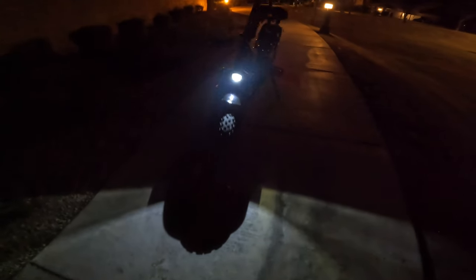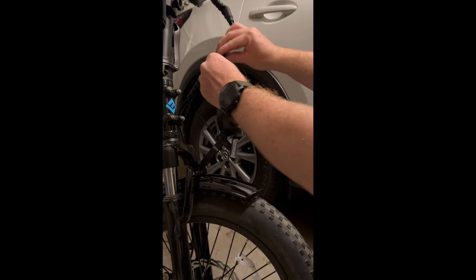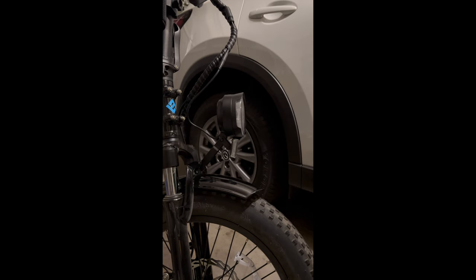The Electric XP 3.0 comes standard with a headlight and a tail light. Unfortunately, the tail light doesn't get any brighter or flash when you apply the brakes — I'm hoping to see this in a future iteration of the bike. It also doesn't have any turn signals, but neither do most road and mountain bikes. The stock headlight is okay if you're riding at slower speeds, but not ideal for higher-speed night riding given its level of brightness. For most e-bikes and e-scooters, I recommend using an optional external light to help with seeing both further ahead and to the sides. I did try Electric's elite headlight, which is a big step up in brightness. The main issue I have with it is that I can't tighten it enough to prevent the angle of the light changing when going over big bumps or rough terrain — if I go over a big bump, I usually have to lean forward and readjust the light. My recommendation for future iterations is to incorporate a locking ratchet mechanism so the angle can be locked in place.